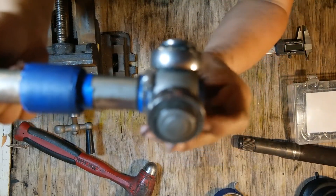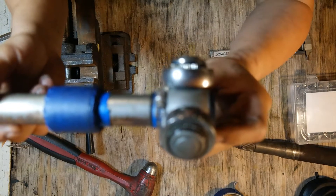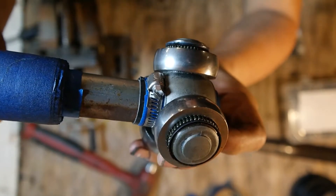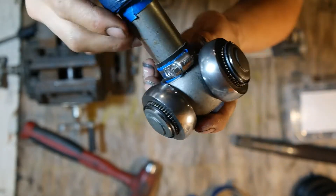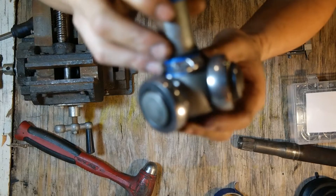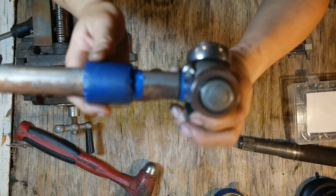I've measured the distance of where my inner tripod bearing needs to be. I have a hose clamp on here, but I'm not sure this piece is going to clear inside where the bearing rides inside the inner CV. We'll see — hopefully it does. It's pretty close. But if not we'll have to come up with another idea, maybe drill some self-tappers or something.